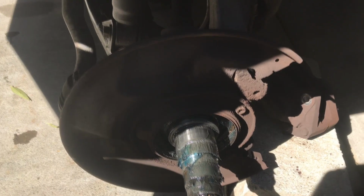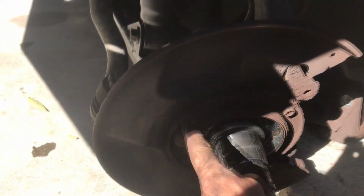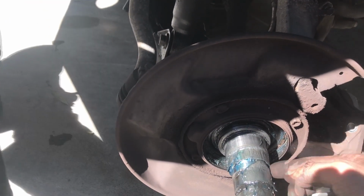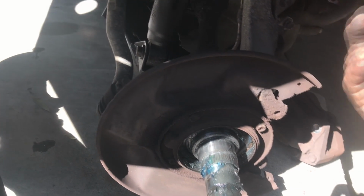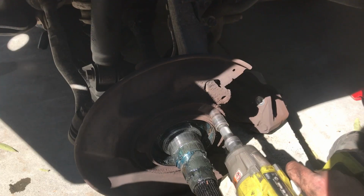These ones are good bolts. Do not lose these. Step 16 and a half. Remove brake disc. Do not drop bearing. It's very greasy. Step 17 is optional. You can remove these four bolts to get the dust cover and this seal off. Helps accessing the back a bit easier. You don't have to do it, I guess, but I'm going to because I need to clean everything.